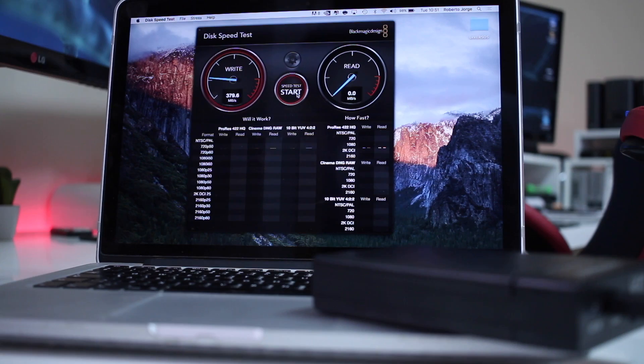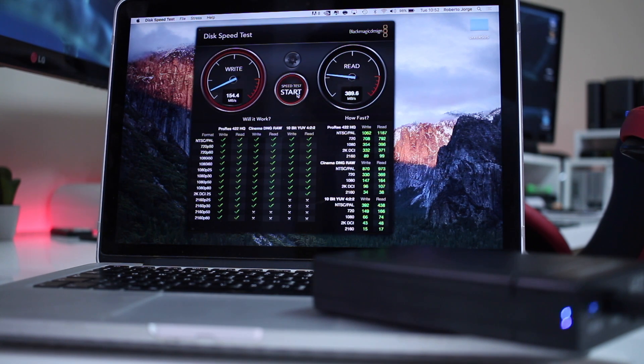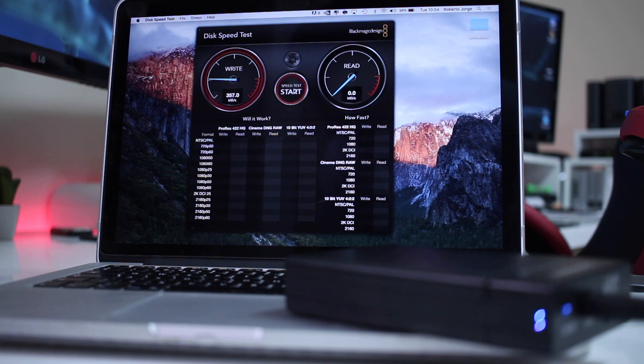The other results I tested were RAID 0 and RAID 1. The results were not as good because the other SSDs I've got are slower than the ADATA, and that means the RAID array will take the slowest speed of the drives since it's using both SSDs or hard drives. So depending on the hard drives or SSDs we use, we can get better or worse results.